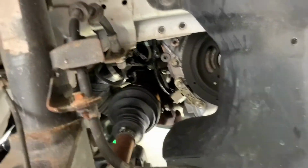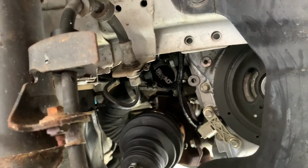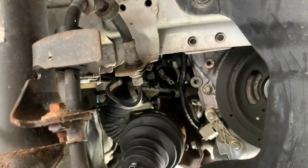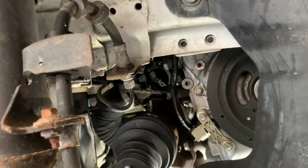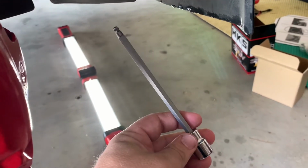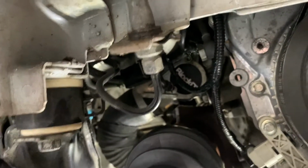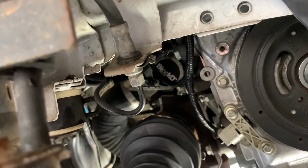So I already knocked out the stock blow-off valve. If you go back to my video when I installed the Exhale Kit, you saw I had tons of issues. I stripped out some bolts and had to wait for another day to get some bolt extractors, but not this time. This time I was well prepared. I had my nifty little Allen key. It's no problem. Right, there's the stock parts coming out. There's the block-off plate, and then we plug the vacuum source with a golf tee.